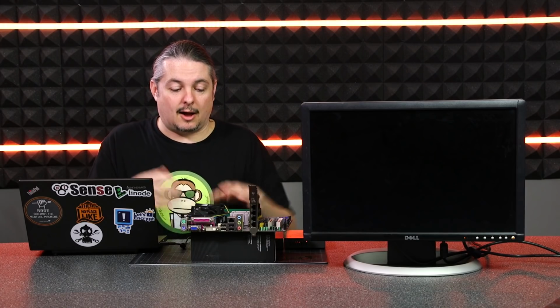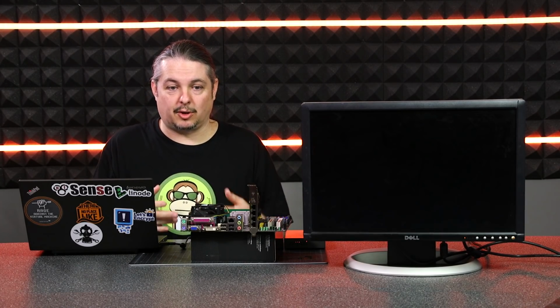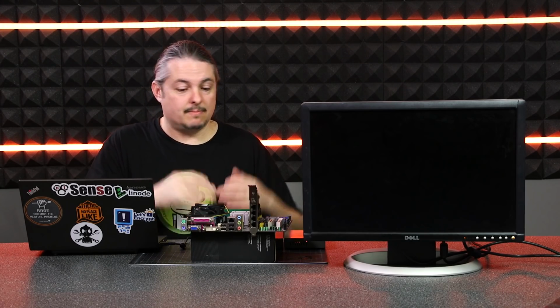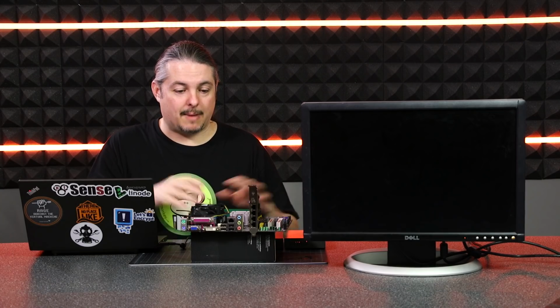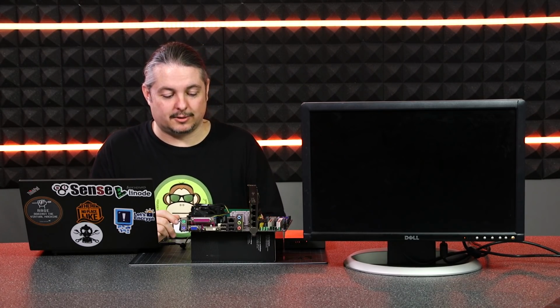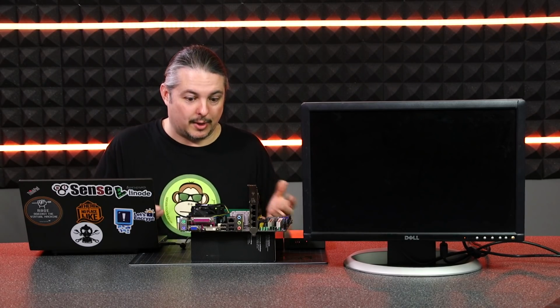But for the most part, if you're not doing any packet capture, you go, you know, I don't really care about all that logging. I'm going to keep a couple days with the logs, which don't take a whole lot. I just want it to do routing and security, no problem. So it'll handle that part and packet filtering and QoS. Those things do not take up a lot of hard drive space. So small hard drives definitely will work. All right, let's get started with actually loading this now.